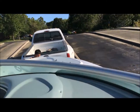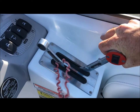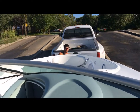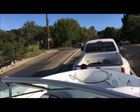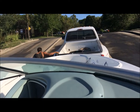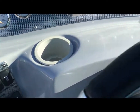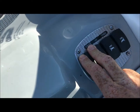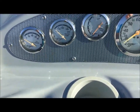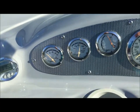One other thing important to remember as you're moving it forward on the trailer: don't be hurky-jerky — that's what gets people hurt. Nice, slow, steady applied pressure while he moves forward, just maintain it. Get it up nice and tight — you want the bow eye on the roller. Always turn your battery switch off and take your plug out when you pull it out of the water. Trailer trim — bring it all the way up. If the key is off, your trim gauge won't come on to show you.